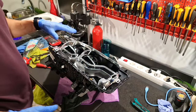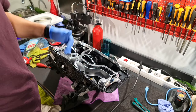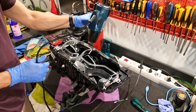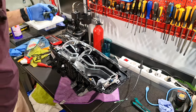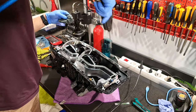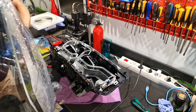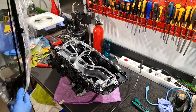Something like that. Now I need to heat this sealant to be more soft, to be able to set perfectly the lens cover. Okay, after 5 minutes, this headlight is hot. I'll make a last check to see no dust. And no marks. Something like that.